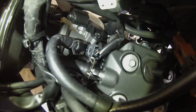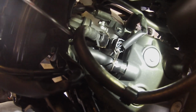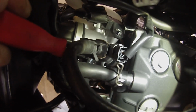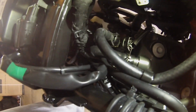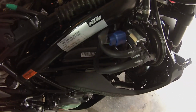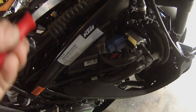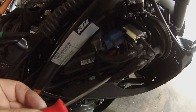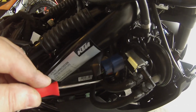It's hard to see in this jumbled mass of pipes and cables, but this is the one here that you'll be coming off of. That is your vacuum line. That one runs here all the way around to this purge valve here, and it's the left of the two lines here. It comes into the valve here and it comes back out of the valve and all the way down the back of the bike. So it's this line here that you actually want to be tapping into.